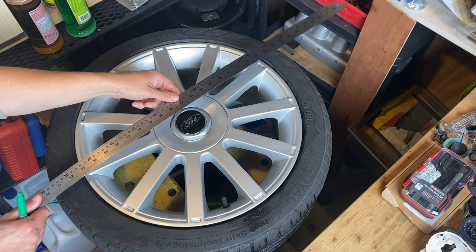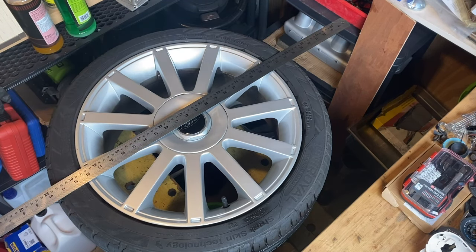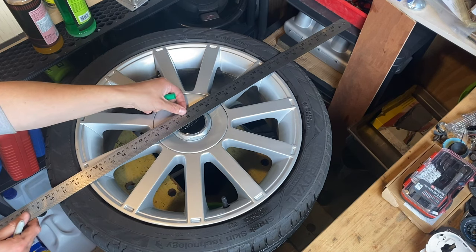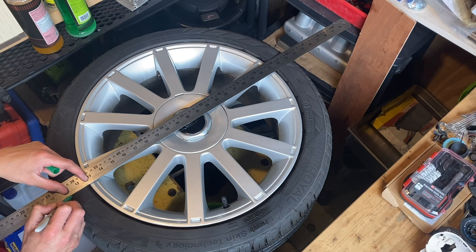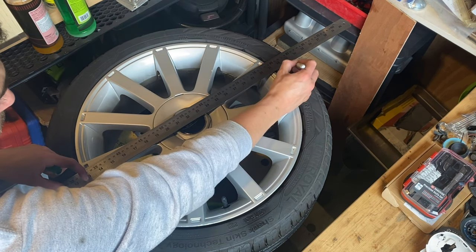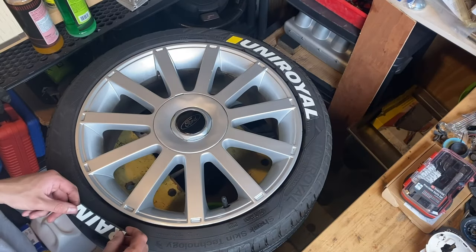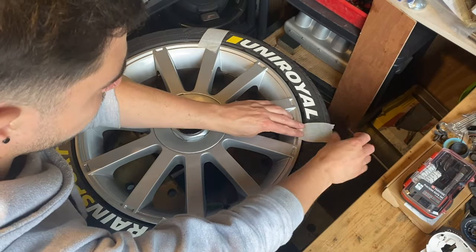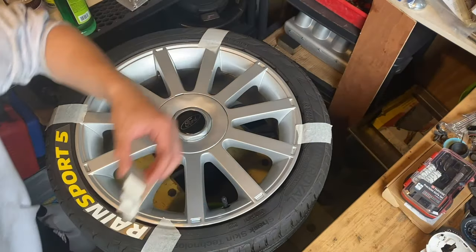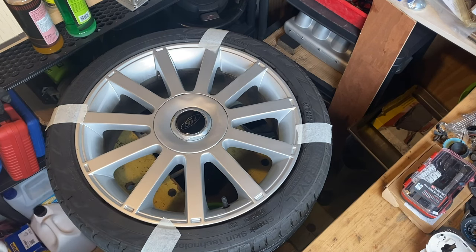Tirewall Stickers have a couple of really great videos on their Instagram and YouTube channels, which I'll leave links to in the description. But nevertheless, I'm going to take you through installing them. You want to install your decals on the smoothest part of the tire, so what I'm doing is marking the centre line at the top and bottom, well out of the way of the original Uniroyal branding. Then I'm just offering up the decals to see roughly how much space they take up, and marking this area using some masking tape. Next, I'm going to remove the decals and set them to one side so I can prep the area of the tire I've just marked off.